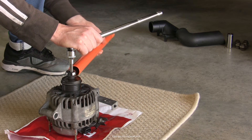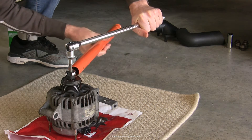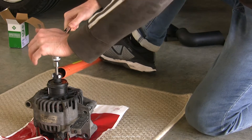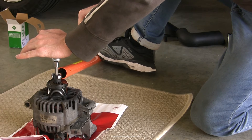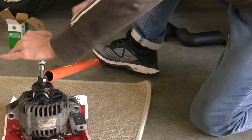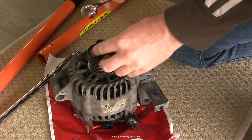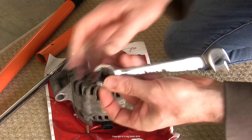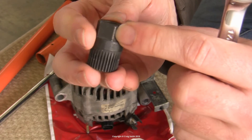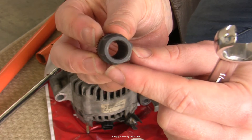Check the thread direction of your pulley — it's not marked on mine. It should be such that the belt direction tightens the pulley. If unsure, examine the new pulley's thread before trying to undo it, because some are left-hand thread. Here I'm holding the nut with my foot and pulling on the tool turning the shaft — trying to undo it counterclockwise — but it's not coming loose. Despite my concerns about the 8mm hex being unfounded, I've managed to ruin the pipe spanner, which opened up so the 17mm hex is now more like an 18mm. The hex on the spline tool is also slightly damaged.